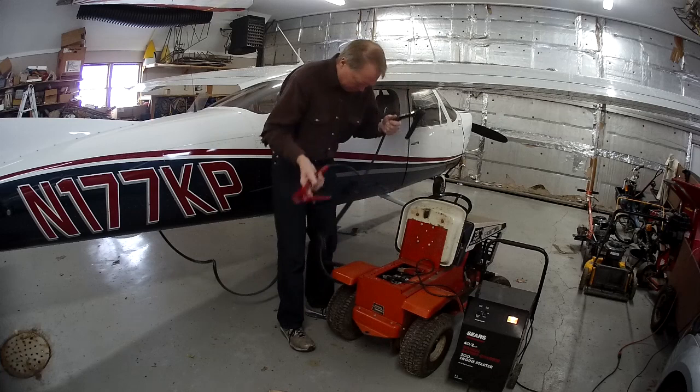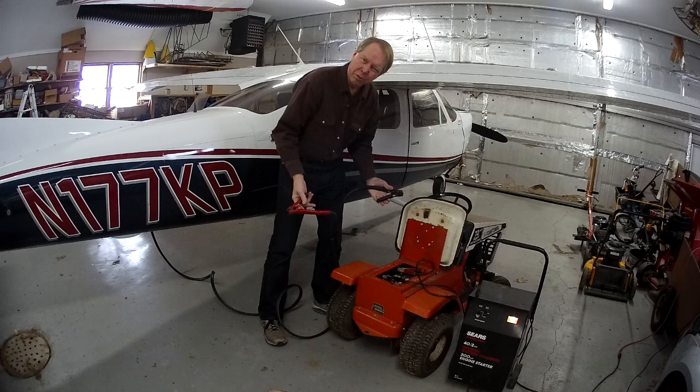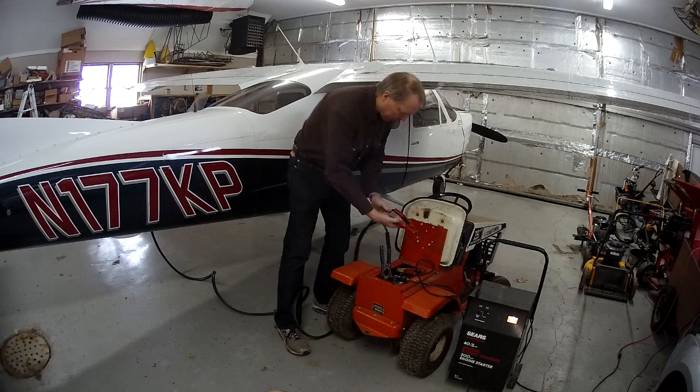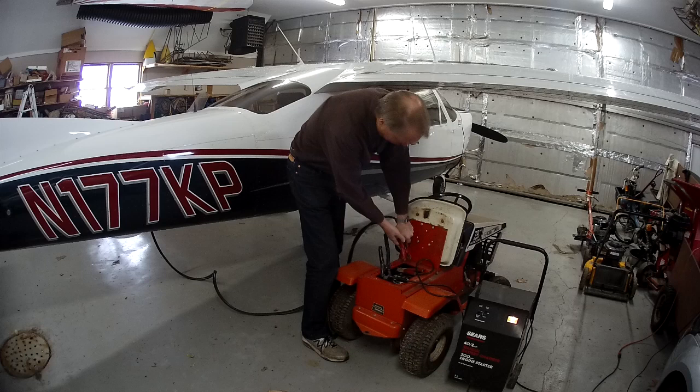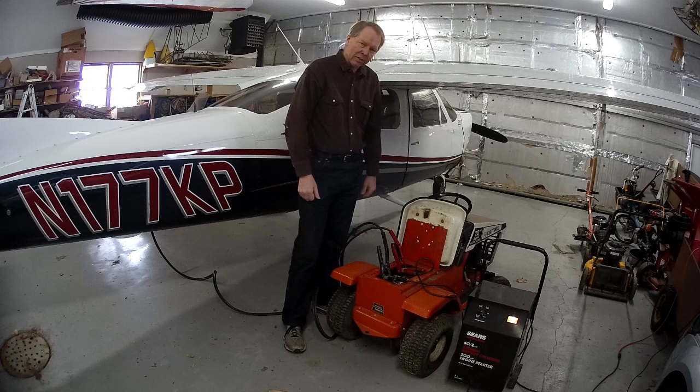What the battery is going to do is provide balance to the voltage so I don't want it to generate a 20 volt input into my airplane — I'd like it to be a 12 to 14 volt input. By putting this battery in here, that's going to lock it at about that 12 to 14 volt range. When I plug this in, the airplane will activate because I've got it already plugged into the airplane. We get the contactor click in, and the avionic system is now powered. The battery is not powered because there's a contactor that stops that from happening, so this powers the airframe without attaching to the battery.